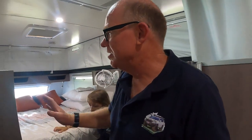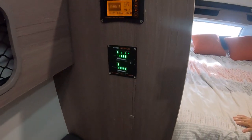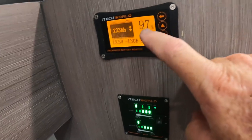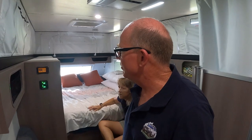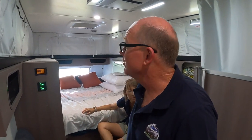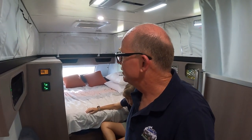It's pretty hot outside and pretty hot in the van - I'll just show you this screen here. She's cranking her heart out: 1,620 watts, drawing 130 amps. At that rate we've got about 1 hour 47 minutes left on the batteries. The best ideal way is to just run it for half an hour - normally if you're out bush at night and you want to cool things down before bed. Otherwise, as you can see, with 240 amp-hours you'd be draining it pretty quick. It's now sitting at 1,821 watts, using 146 amps. It's pulling a bit.